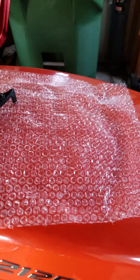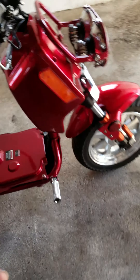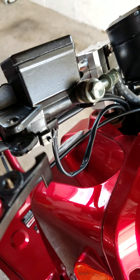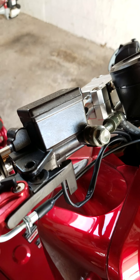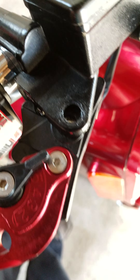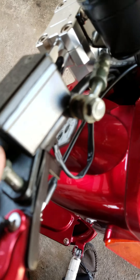Now I haven't test-fitted this one yet but it should be pretty easy. It's also good to mention — with either one of the levers, try to get some grease in there, because metal on metal rubbing against each other will eventually wear it down, and obviously you don't want to prematurely wear down your brake levers because that would probably not end well. Line the hole up and then same thing — get your little bolt and shove it in there.